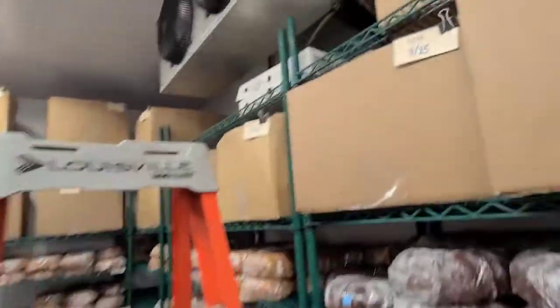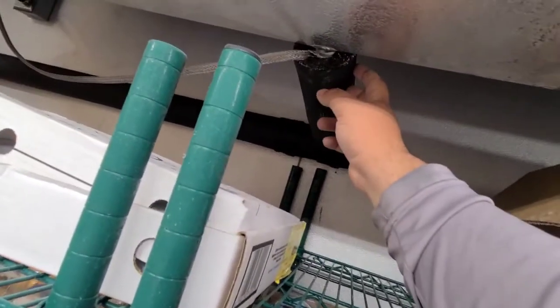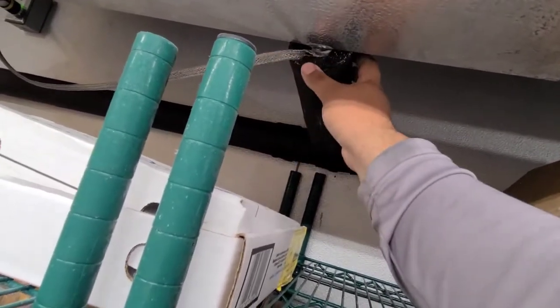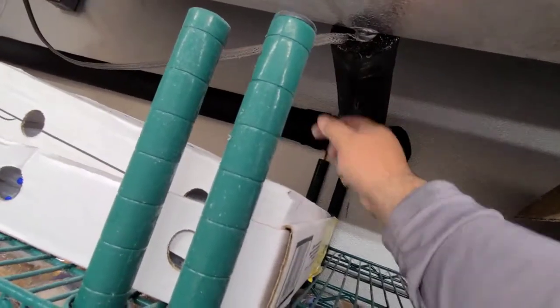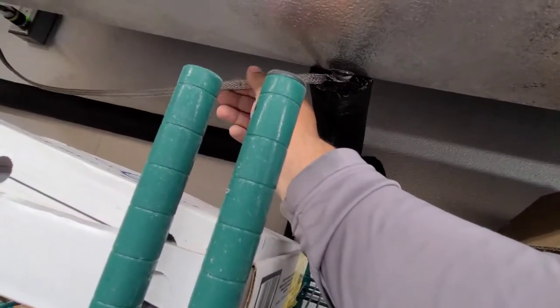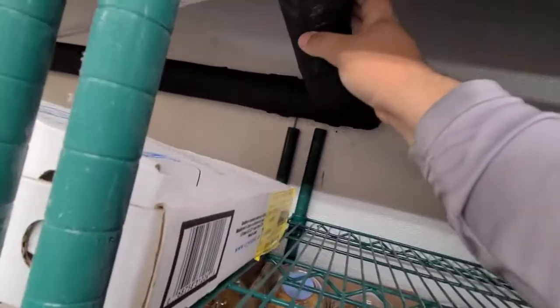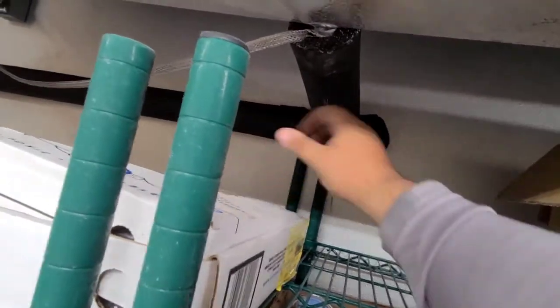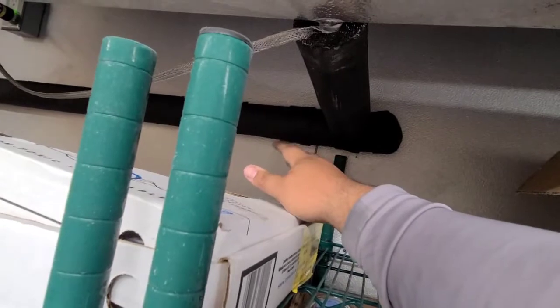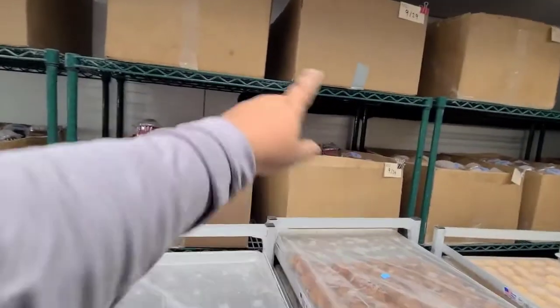This one is the freezer — it is 10 degrees in here. So because this is a freezer, below 32 degrees in the box, you have to insulate the drain, it has to be run in copper, and you have to run a heat tape to it. That heat tape should plug into an outlet so it's getting 120-volt source of power, and it's just warming up, keeping it just above 32 degrees. You wrap it around the drain line and then insulate it — gotta make sure it doesn't turn to ice, then the water is just going to build up in the pan and you'll start seeing it overflowing. And this drain line is run into the walk-in cooler, which is on the other side.